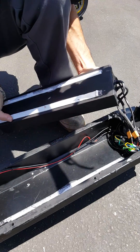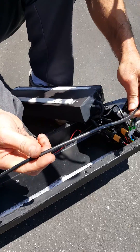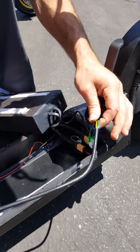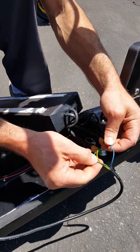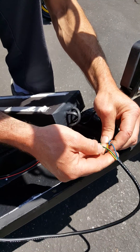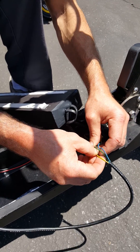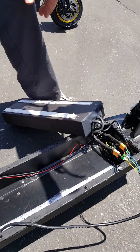Here you can see the tape. Once you've got that out of your way, you're gonna get to these, and you can see that these are smaller gauge wires. Sometimes people were having problems with these getting too hot, so what we're doing is we're putting larger gauge wires on. We'll show you what it looks like over here.